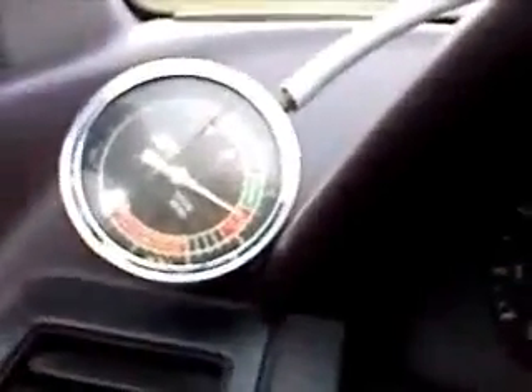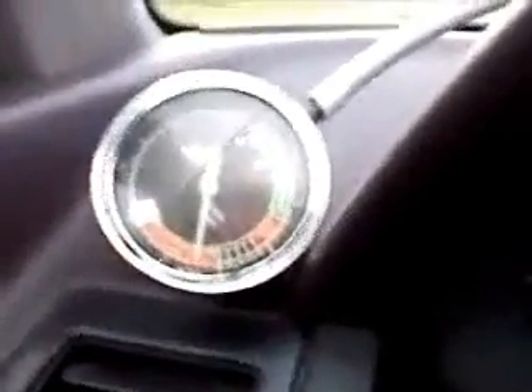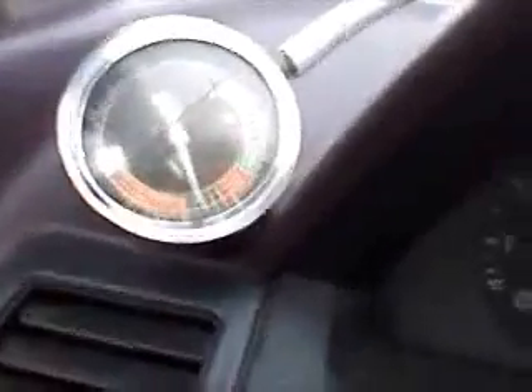But in real life, that's not what you see on the road. And that's what I really wanted to demonstrate here today: as you're driving along, there are major fluctuations in the intake manifold vacuum. Attaching a cell directly to it, while it will increase the output of the cell, is not increasing it in the way that you want it to go.